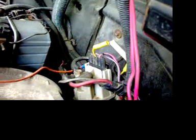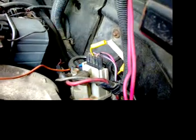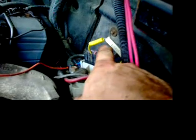Now, if you don't disconnect anything, when you throw the switch in the cab the wait light will come on, even if the glow plug cycle normally — they'll cycle normally. The way I have it wired now, that right there is a 1 ohm or 10 ohm resistor — I'm not sure which — you can look it up on the forums. That lengthens your glow time to about 15 seconds.